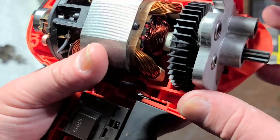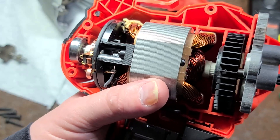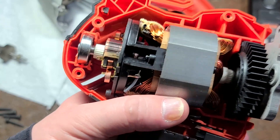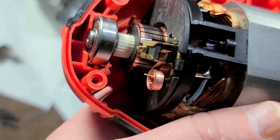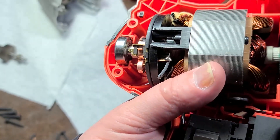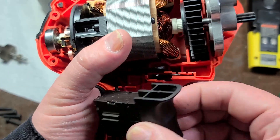We can see a ball bearing in the back of the motor and a needle bearing in the diaphragm at the front. So this is all ball and needle bearing except for the primary spindle. It has fine contact — it is still a pretty high speed motor. We have copper plated clock springs to the brushes, and these actually look like they're the exact same size as in the DeWalt half inch drill.